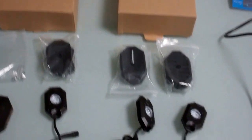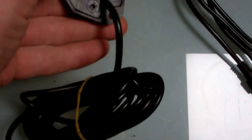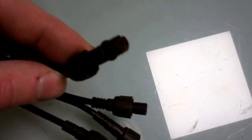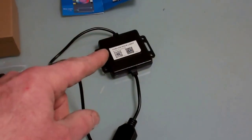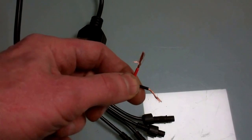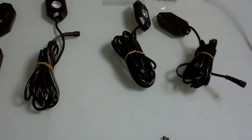In the pack you get the instructions and a big box with some other boxes inside. You've got four LEDs — these are RGB multi-colour LEDs on a solid aluminium heat sink casing. The wire comes out the back. You've got a four-way plug and four of those all with the same length of wire. They connect onto waterproof connectors which go to the control pack that communicates via Bluetooth to your phone. All we need to do is connect the negative to earth and the positive to the welcome light feed.